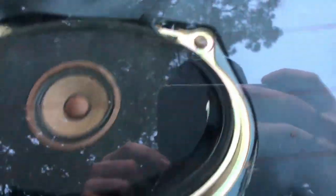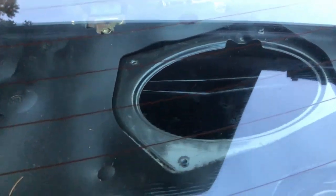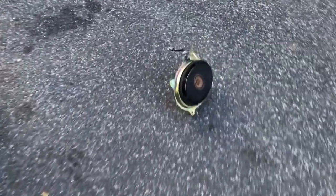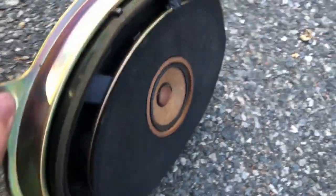We made it back to the spot. You've got these four screws here — these happen to be 10 millimeter. You start to see that? They're out. You could go through here to pop them out if you need to through the trunk. There's a little clip right here, you just unplug them. Four screws — comes right out.